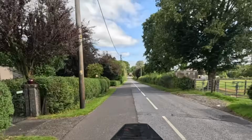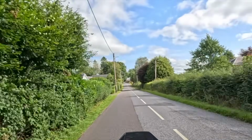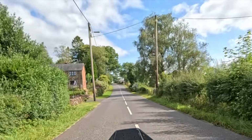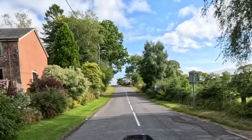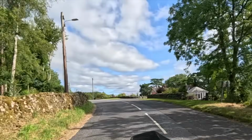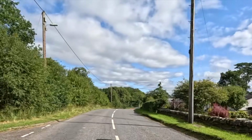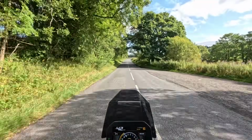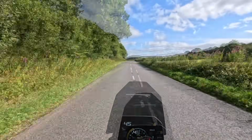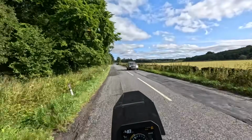Well, the verdict there is, I'm worrying about slipping the clutch. It kind of slips the clutch for you. So I was thinking I'd have to have it over 2,700 revs and then use the lever to slip the clutch to get over any sort of obstacles. And that would be true if you were riding with something a bit more knobbly gnarly. But actually, with a bit more getting used to it, you can really let the easy ride clutch do it.